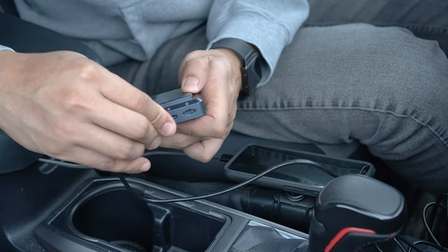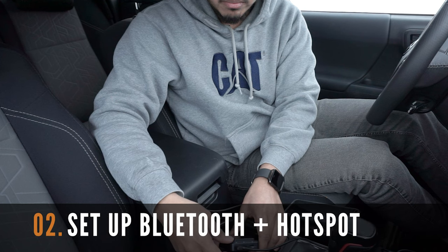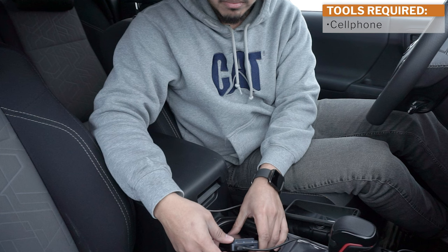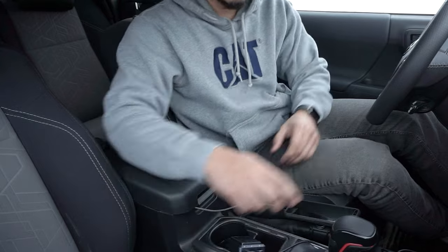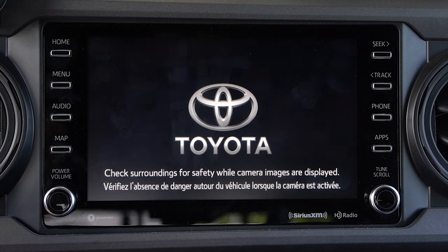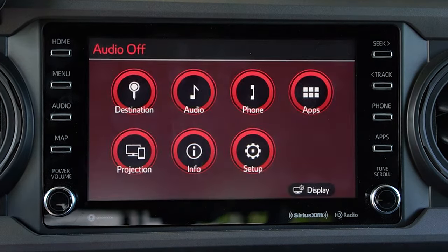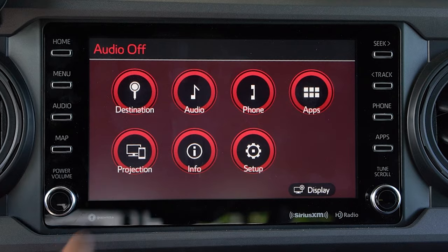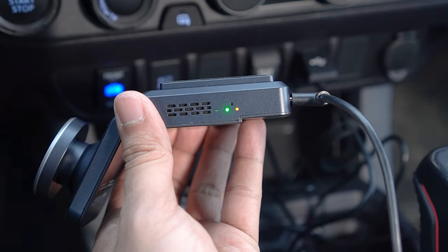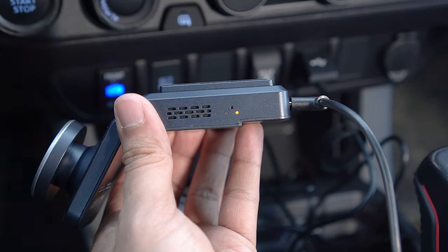Proceed with setting up your Bluetooth and Wi-Fi hotspot. To connect the 2-in-1 wireless CarPlay with dashcam to your truck, you're going to need your phone with Bluetooth and Wi-Fi hotspot turned on. You only need to do this step once and the device will automatically connect to your phone, allowing for wireless CarPlay and dashcam capabilities. Turn your truck on and follow the normal prompts on your entertainment system. Hit the menu button and keep an eye on the projection tab — this should change to CarPlay when the box is fully connected. The middle green indicator light will blink slower when the device is connected.